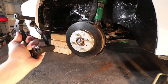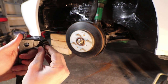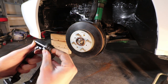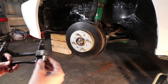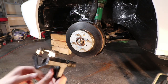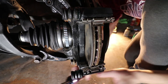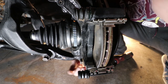Nice little blob. Next we'll get this guy on, it can be a little difficult. There we go, that's one. Alright so that's ready. Shims on there. Alright so that's done now and we're going to go ahead and put this guy on. 17mm bolt on the bottom and on the top. Tighten it down and torque these two guys at 80 foot pounds.